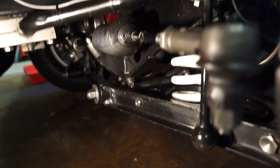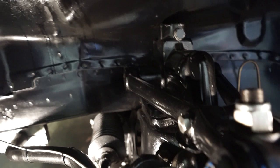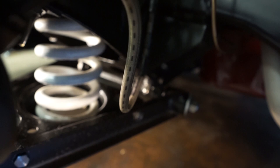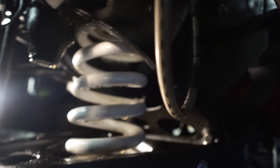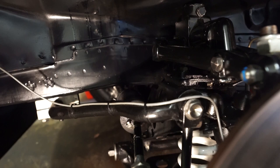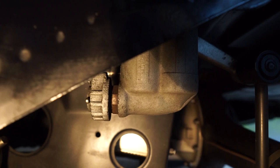For the front suspension we're using the stock MGB system - we're not allowed coilover dampers or anything like that. We've got a lever arm at the top that's an uprated one with shims added into the valve to make it a little stiffer; you can add or remove shims to adjust the suspension. The springs are 800 pound weight, a little bit stiffer and shorter than standard, with two-and-a-half inch internal diameter. I've made a small modification to the cupping cross member to hold those in. The wishbones are the negative camber ones, giving us over one and a half degrees negative camber on the front.